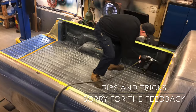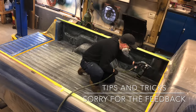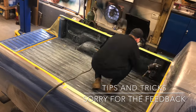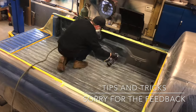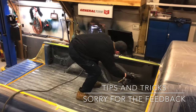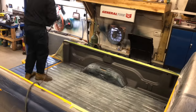I'm going to do a voiceover while you watch me spray and run back through the steps with some tips and tricks. The steps are as follows: get your project clean — either wash it with soap and water and let it dry, or at minimum blow it out, sweep it out, and hit it with wax and grease remover. Your next step is your prep. I recommend 180 to 320 grit sandpaper — 180 to 220 would be optimum, 320 would be the finest I'd go. Sand all your areas, whether you use the orbital with the interface pad or by hand. Once you're done sanding, go over the whole area again with Scotch Brite. Get all the hard-to-reach spots. Anywhere you think this product is going to land, you want it scuffed — you don't want it peeling on you.